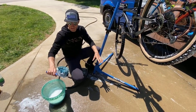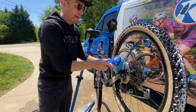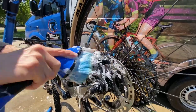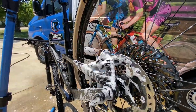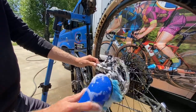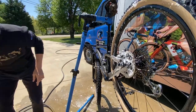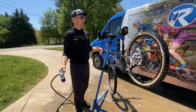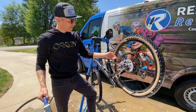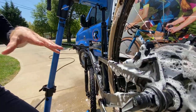Use your clean frame brush — make sure there are no contaminants in it — and really clean around the caliper because you get a lot of brake residue that builds up there. Rinse your brush, then clean the rotors. Rotors don't often need a lot of cleaning, but getting most of the grit off is perfect. After that, you probably notice when you spin your wheels — especially after a muddy ride or rain — you hear all that grit in there. That's what we want to get out.